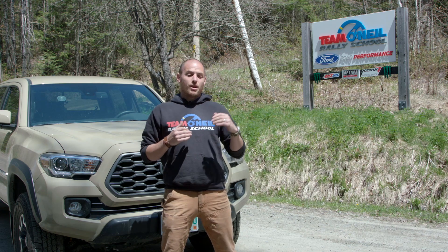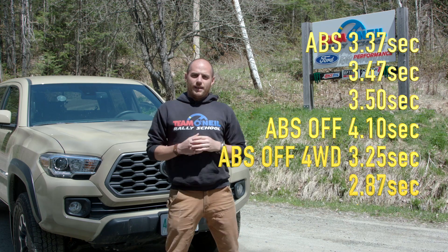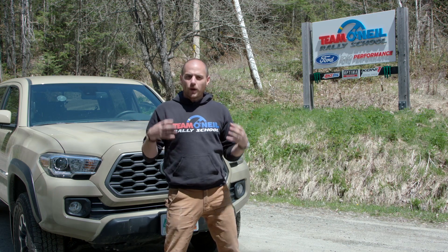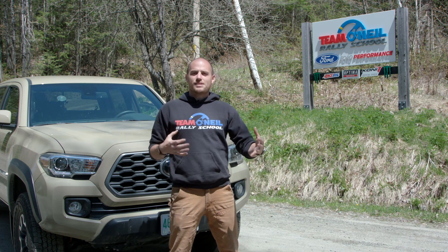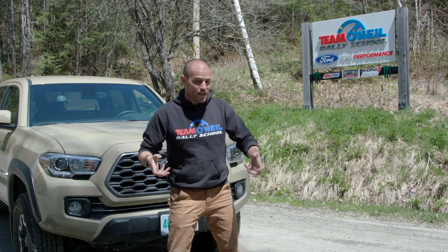Really interesting experiment. With the ABS on we did three tests, all in that mid-three-second range. As soon as we disconnected the ABS, braking was actually worse — the front tires wanted to lock up quickly and the rear brakes were doing almost nothing. The reason is that in any modern car, the ABS and stability control systems work in unison and control brake distribution — your brake bias from front to rear. So when we pulled the ABS fuses, we really only had front brakes, which is why braking performance was so poor. That run came in at just over four seconds.